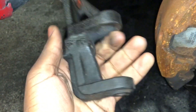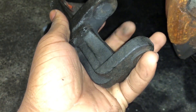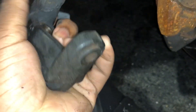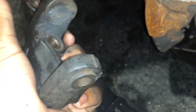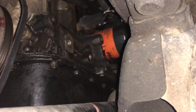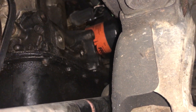This is the alternator bracket that holds it up from the bottom. I went ahead and ordered that missing bolt from an OEM Honda website — I'll link it down below when I get this finished and edited so you can find the website for other parts you might need. That should be here later this week. Right there is where this bracket has to go in, held by two 14 mil bolts. Then all I have to do is put the alternator in back up top, align everything, retighten the belt, and reconnect the power.